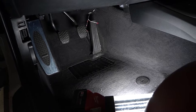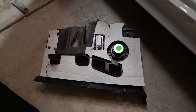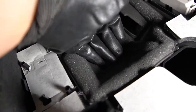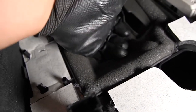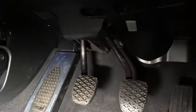This video is a lot shorter than I expected — I thought I had to lubricate the pedal but turns out I didn't. I'm going to put the undercover back on to see if it squeaks; maybe I just had it on incorrectly. This is the undercover right here, where the pedal travels through. I just accidentally rubbed my hand up against this foam piece here and it made a similar squeaking sound. Maybe the pedal is rubbing too close against this foam, so I'm going to try to realign it properly — and the squeak goes away.